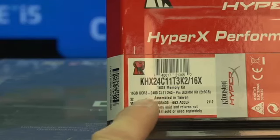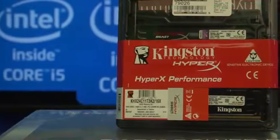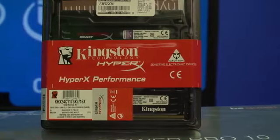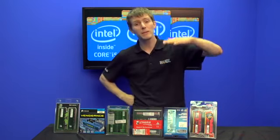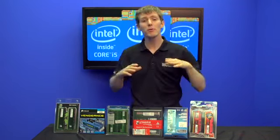All of a sudden, those high-speed memory kits — some of which couldn't even run at stock speed on many Ivy Bridge chips — can stretch their legs fully with Haswell. The one thing to bear in mind is that once you start to overclock the CPU core speed, your memory frequency ceiling does start to lower. You can pretty much guarantee that once you're overclocking to 4.4, 4.6, or 4.7 GHz, you're going to get anywhere from DDR3 1600 to 1866 or maybe 2133 if you're lucky. Thank you for checking out this Haswell Buyer's Guide. Don't forget to subscribe to NCIX Tech Tips for more videos like this from NCIX.com.